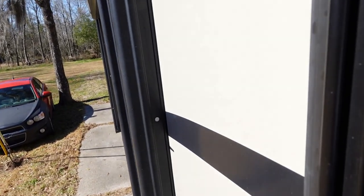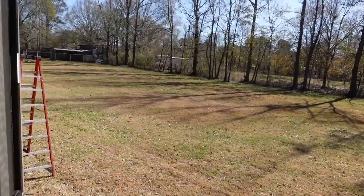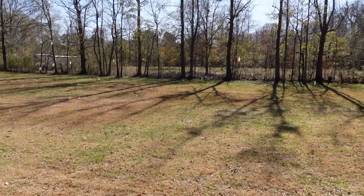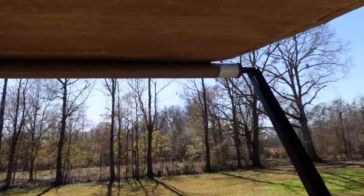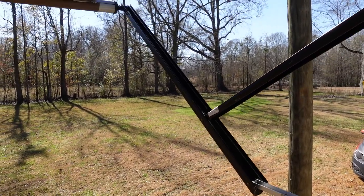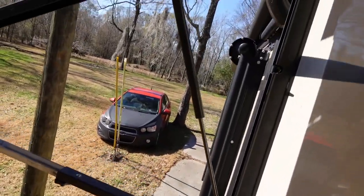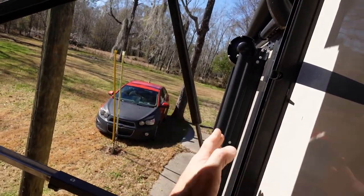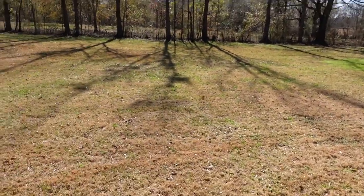Now what we've got, all right. Well, of course, this time it's gonna work. Oh, there it goes. That clunk, which I'll explain in a minute, is a result of what I believe is these shock absorbers having worn out. They're not pushing the thing away from the coach as consistently as they used to.